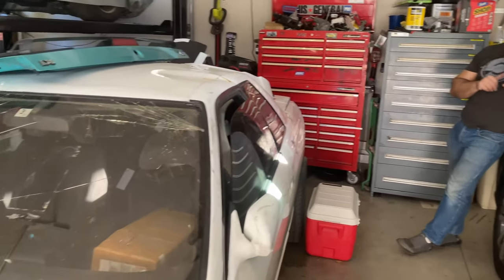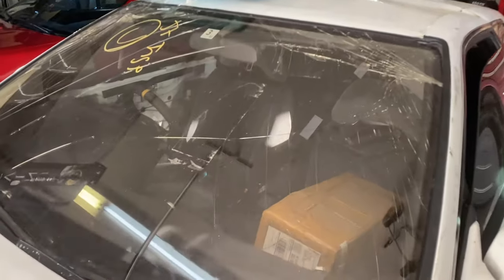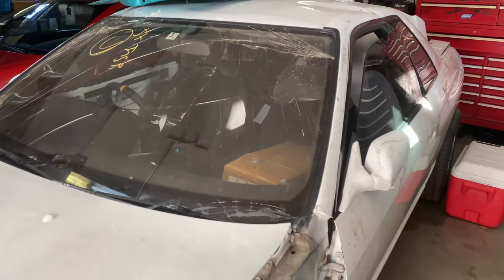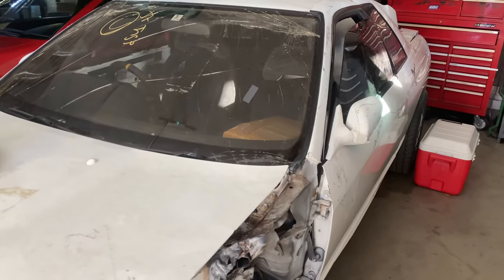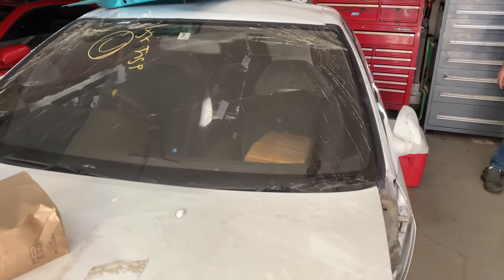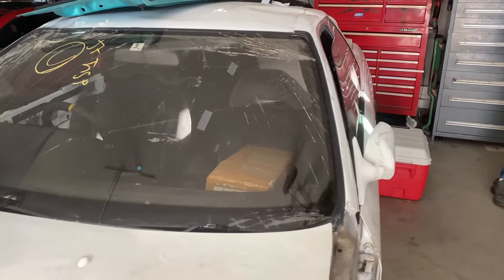Because this is a right-hand drive car, five-speed manual. And the only thing left as far as suspension is I just got to fix this frame support here on the left front side, pull it out about 4 inches, and then forward about 2 inches, and then I'll be able to structure it together and finish putting this car together and get it on the road again.